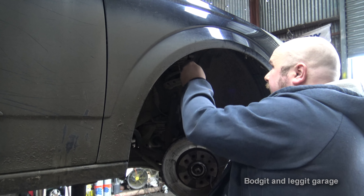Let's get everything back together. New disc — as you can see it's got this shiny coating over the top which is to help stop it going rusty when it's being stored. So I've got some brake cleaner. I know it says WD-40 on the bottle but it's not WD-40, and you do not want to put WD-40 anywhere near your brakes. This one with WD-40 in it is not the one — make sure you use actual brake cleaner.